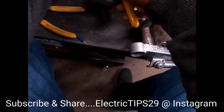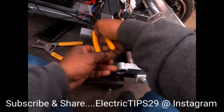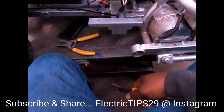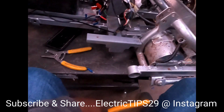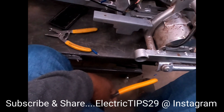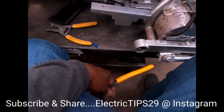Note, never work with the battery connected. Also, before you disconnect the battery, turn the unit on, then disconnect it and give it gas, just so that it takes all the power out of the controllers, because the controllers act like a capacitor which stores power. So when you first plug up a controller, if it doesn't have power stored in it, you should hear a pop.